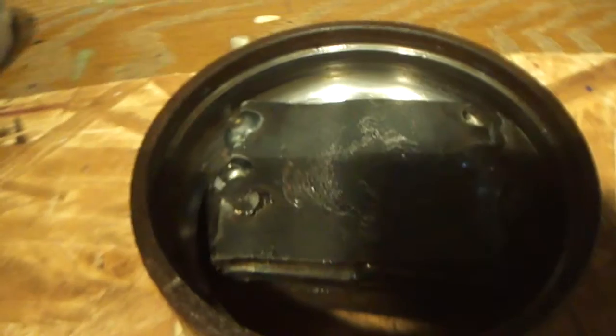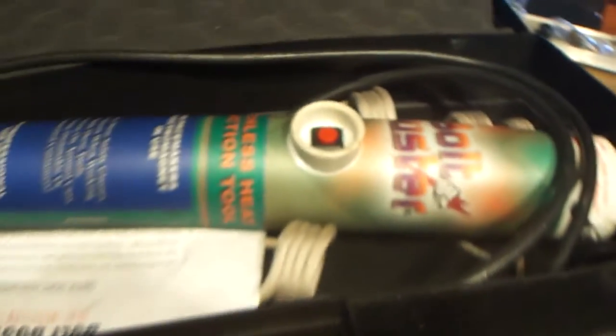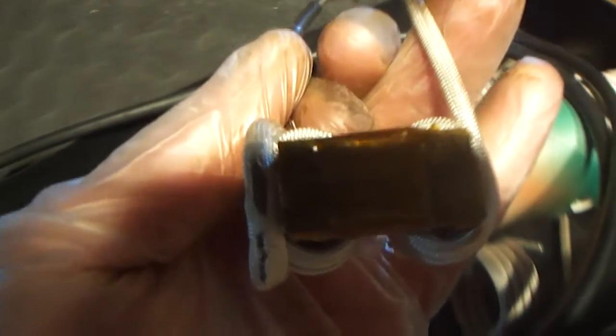So then I got to thinking, what have I got at my disposal here? I actually use this device called a Bolt Buster when I'm working on cars — it's actually pretty handy. It does pretty much the same thing as an oxy torch except you don't have to worry about flames. You can use these adapters to get around the nut and the bolt. This accessory here I purchased for 25 bucks — it will just go in and heat a component. I bought this about a year and a half ago, probably one of the best things I've ever done. I'm not really that comfortable having an oxy-acetylene setup in the garage. Anyway, long story short, this is my go-to tool.